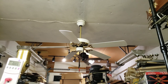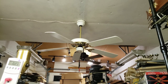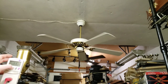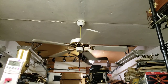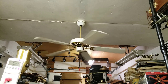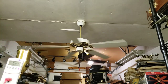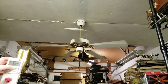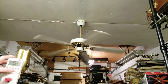Alright, so we're stopped. Let's do low. This is factory low — normally we would start on factory low, I just didn't think to check what speed it was on first. Watts: you're at 11.1 watts. Yeah, I'm guessing about a 50% power factor. Less than that — 0.4 power factor. Going to medium: about just under 30 watts and about 0.65 power factor.